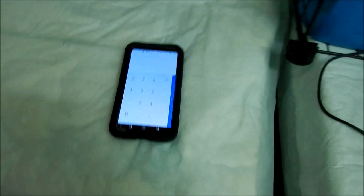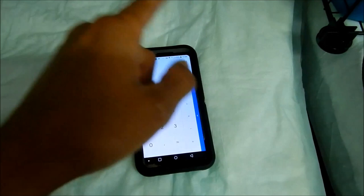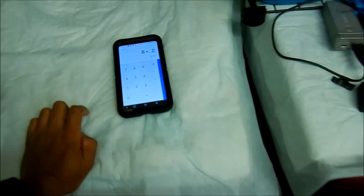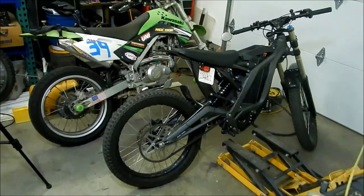To show you the exact sag to dial in: it was 8 inches of travel and you want 20%, so you multiply 8 times 0.2, which gives us 1.6. That's how I got that number — it's 20% of 8, which is 1.6 inches. So you want the suspension to sag around 1.6 inches. I might add a little bit extra because I might be wearing more gear later. Most people say just tighten the collar until it doesn't move and then tap it a little more with a hammer — but that's not the proper way. This is the precise way to set your sag.